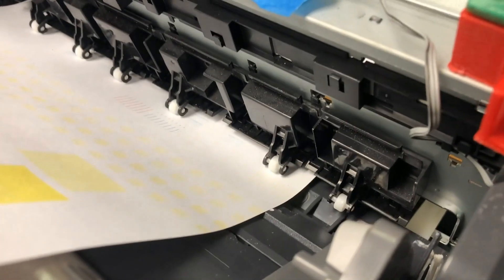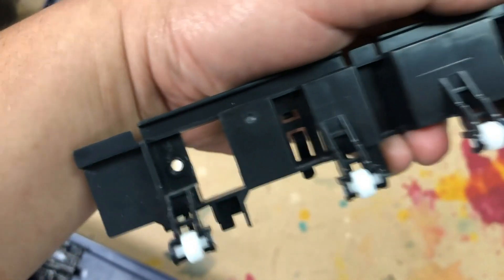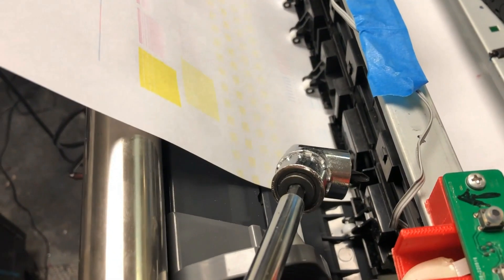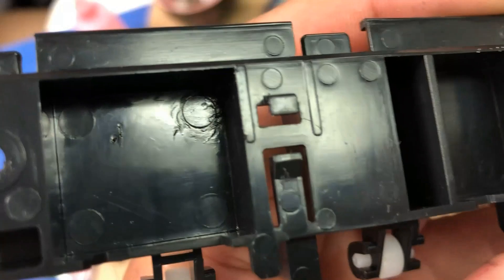Take a look at the back of your printer. If you still have this plate in place, you can take this plate off. There are three screws. To remove those screws, I use an angled screwdriver, but Epson suggests you take the whole back side off. If you don't want to take the whole LD roller off and do what Epson says, I'll put an angled screwdriver link in the description of this video.